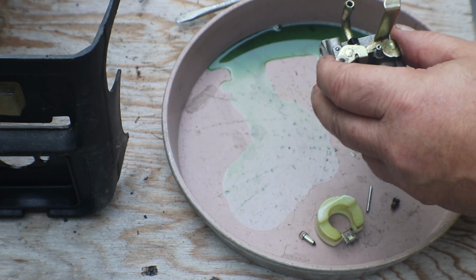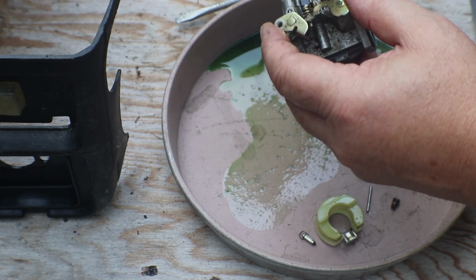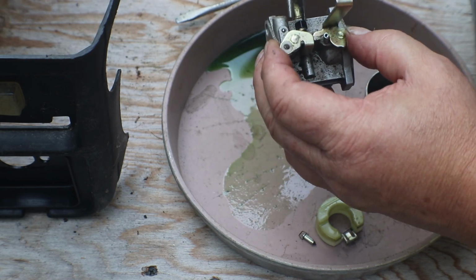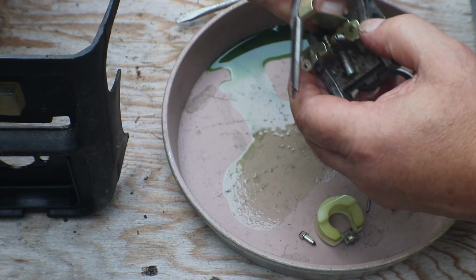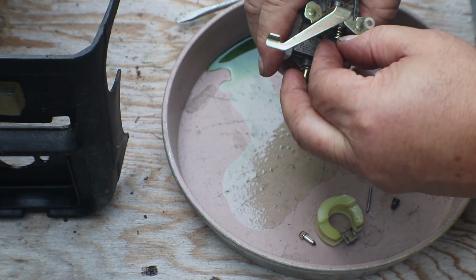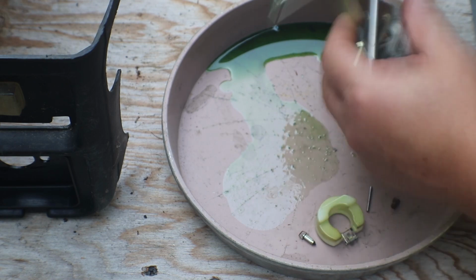God, you have to take the idle out of it before you can get the... Boy, that's not very tight either. So it's been sitting for quite a while. Looks like maybe a lot of the gas may have went down through the... Oh, shit, that plastic cap's not doing anything but spinning. So it's preset, and you're not supposed to be able to adjust your idle.